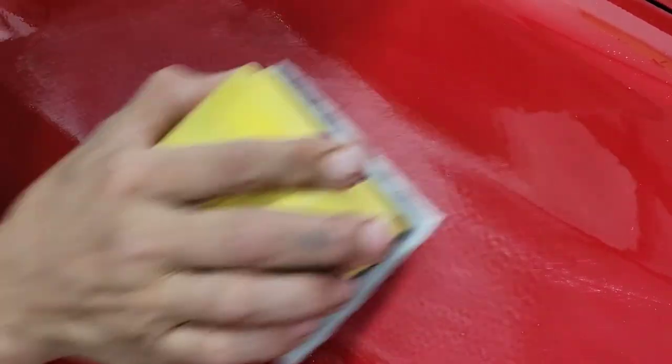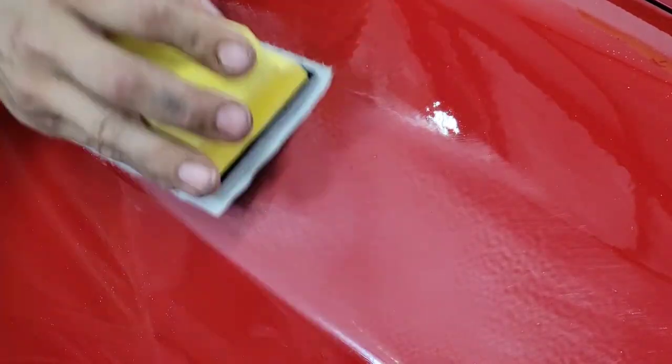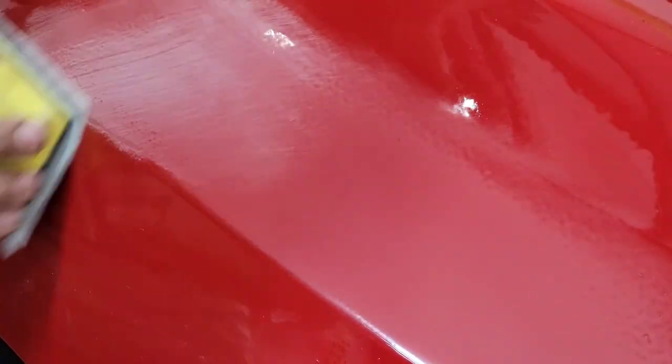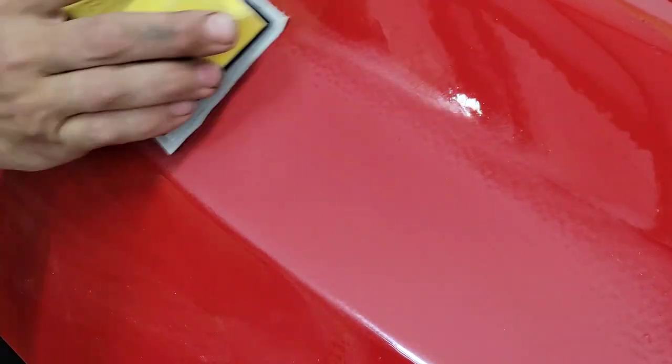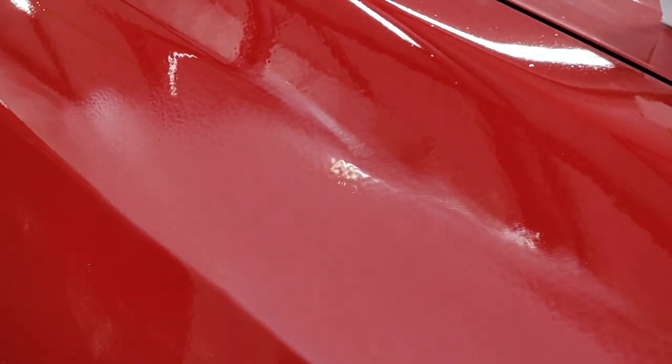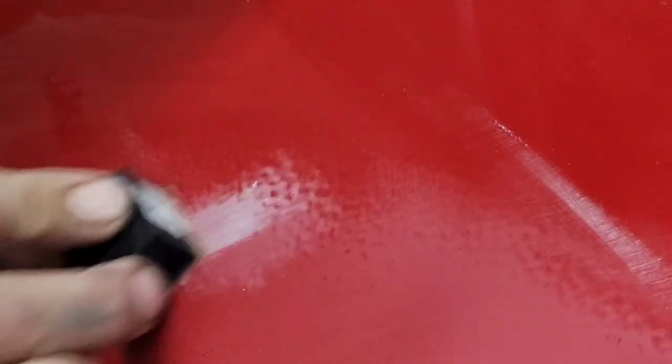You can see the finish now — really, really beautiful, really smooth. From here this is already at the sanding stage for a buff. One tip: get yourself some microfiber, it helps a lot. Just sand a little bit like that and wipe it down. Over here there'll be another dirt nib — it's not really that bad but it's right here — and this is just to remove the dirt nib or the imperfection from your paint. Beautiful, it's gone.